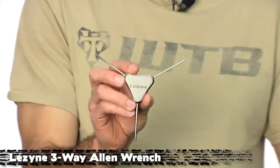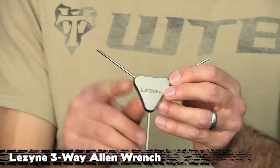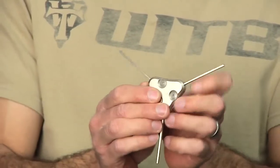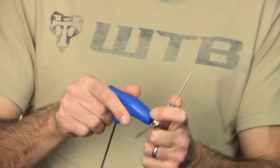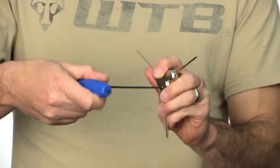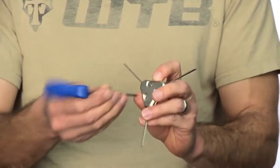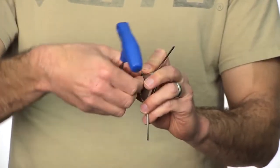Another innovative product for 2012 is the Lezyne 3-way wrench. Previously, if you needed one of these you grabbed for the Blue Park, but you might have a reason to try one of these. CNC aluminum body, steel bits — very high quality. These bits will last you a long time, and if for some reason they do wear out, this is a rebuildable tool. You just take your 2.5mm wrench — look at that high quality build at the Lezyne factory. You simply take out these bolts in the back, and they do give you a fresh set of hex keys, which you can also just use as an extra set. A lot of people won't even wear these out — you have to be doing a lot of wrenching to wear these out.